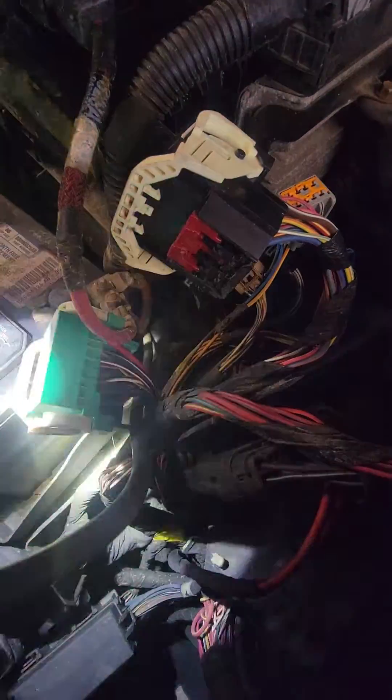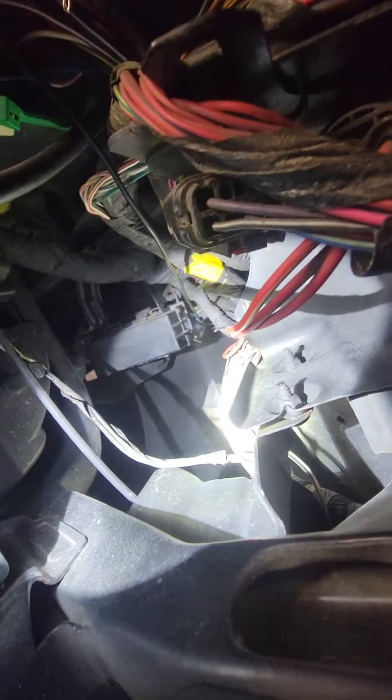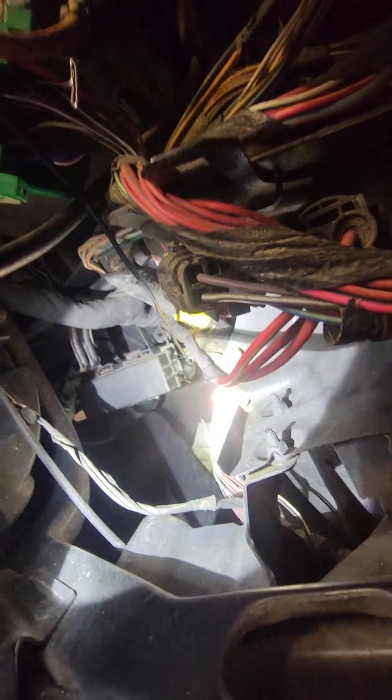So what we're going to do is try to reach my hand down there, because that's where the horn is. See where that painted nut is? That's the hold-down of the horn, and the connector is right there. So we should test the wires. The setup we've got going on here: we've got a T-pin in the back of the connector for the TIPM output — or fused input — and down there on that alligator clip is the one-wire connector where the horn is.